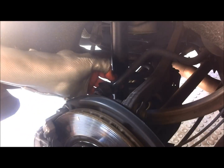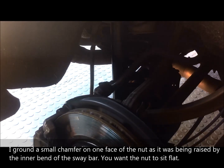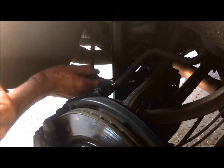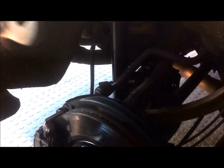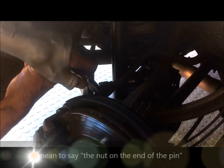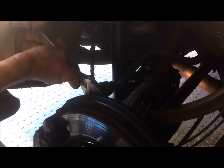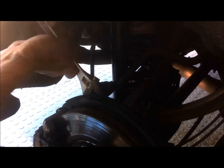I'll put the nut on. I'm going to use my 16mm ring spanner. As I suspected, this nut on the end of the bush is an odd size — it's actually 21 and a half, because the 21 wouldn't fit and the 22 was too loose. So I'm going to have to use an adjustable spanner on it. That's better, now I can tighten it.